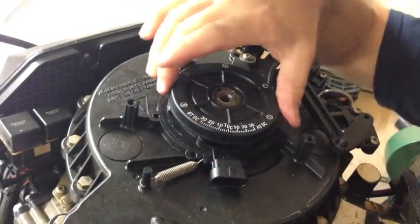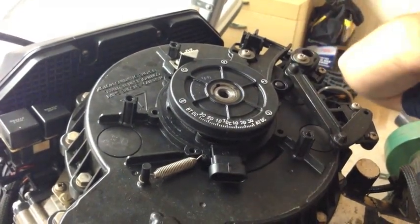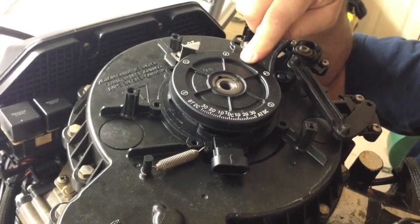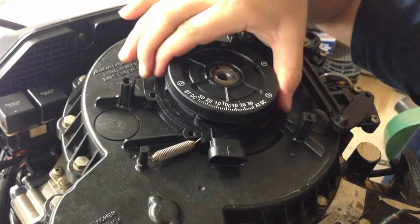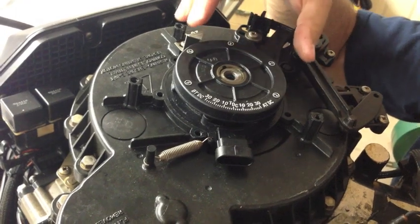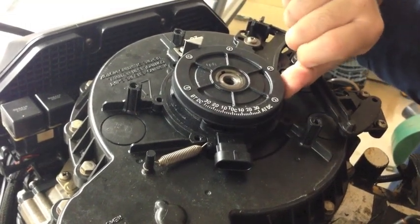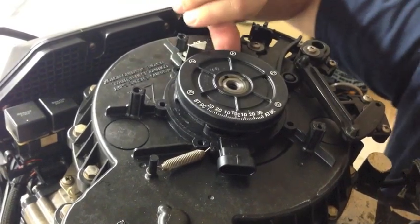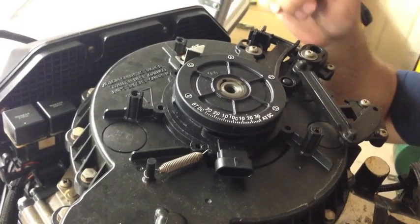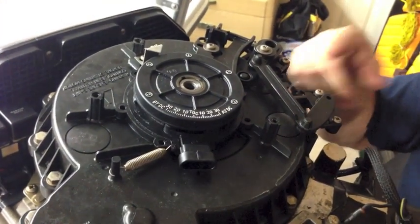We're not able to get this cover off — I'm worried we're going to crack it, so we're just going to leave it. I'll have a spare optical sensor if it runs well. If it doesn't run well, I'll order this cover in case I break it trying to take it off to replace the optical sensor. It's really seized on there. I put some lubricant and anti-seize in here to try to get it to loosen up. I don't really want to put a gear puller on it because it's plastic and I think it'll just crack. As I was trying to work it free, I did hear it creak and crack a little bit, so I don't want to push it — especially if there's nothing wrong with that optical sensor anyway. We're going to finish the installation and leave the old optical sensor in.